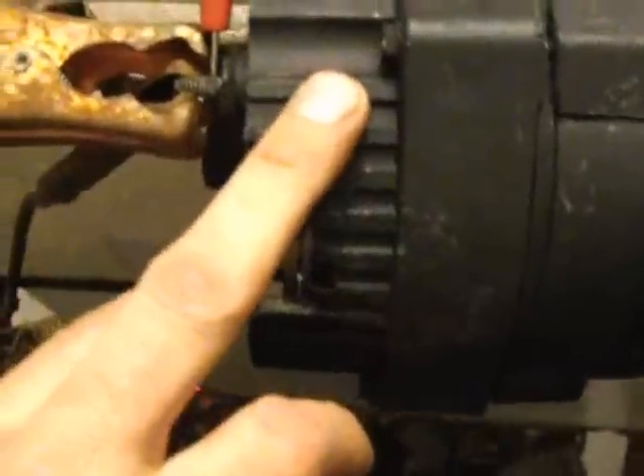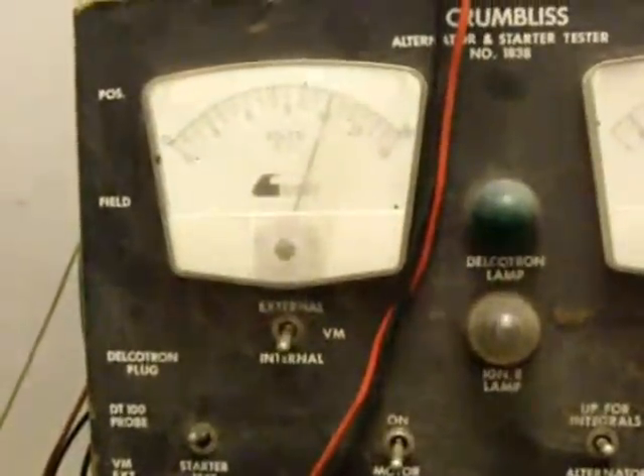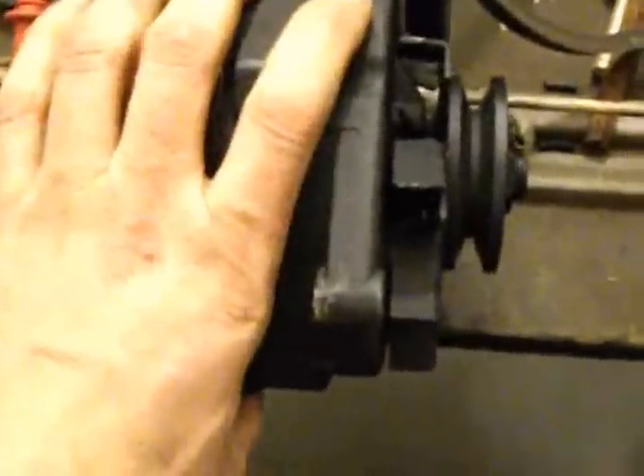I'm going to show you how to take this thing apart and how I built it, and what you've got to have to build it. I'm also going to be working on another project, trying to get that actual charging voltage to where it should be when this thing is running about five to six hundred RPMs. Right now it kicks in at about five hundred RPMs, but it doesn't actually put out charging voltage to almost just under a thousand RPMs. I'll get back to you with another video giving details — I will actually disassemble this, show you everything in it, where to get it, and how to do this all yourself. This one is actually brand new and has never been on a vehicle. I bought it brand new and then modified it. I will keep you posted.